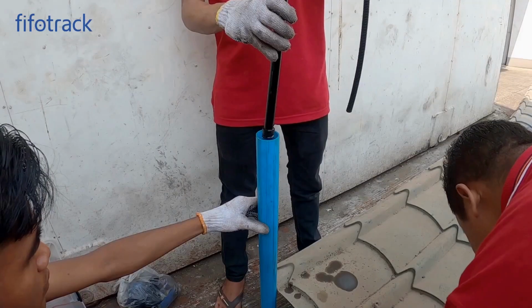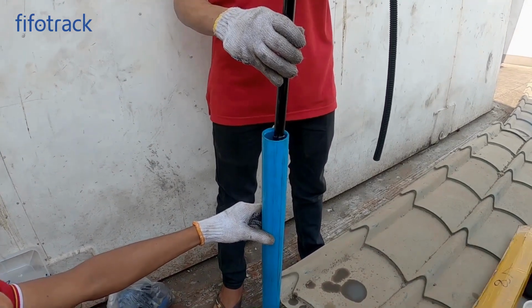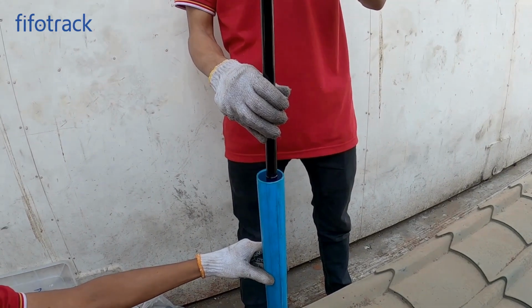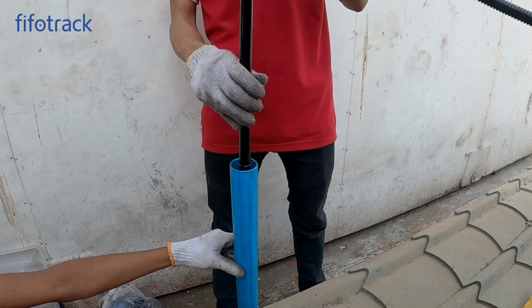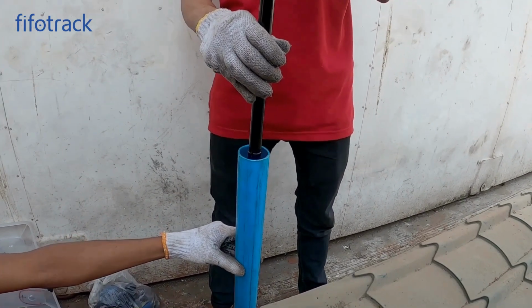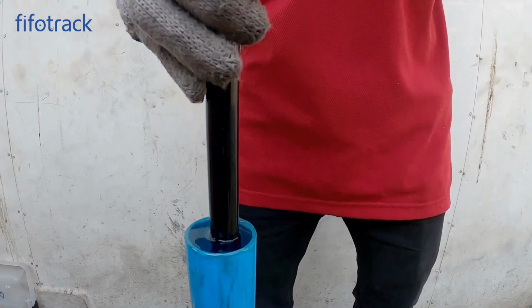The calibration depends on the liquid type and height. So you can use a container with the same liquid type and height instead of the real tank. First, calibrate the full level, then the empty level. Otherwise, the sensor could not enter the setting mode. Put the sensor into the container slowly.